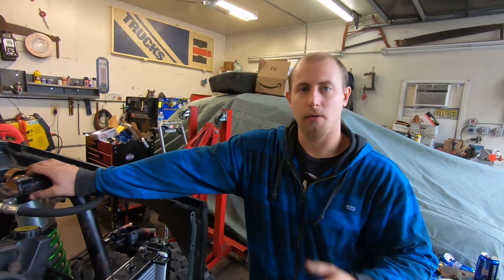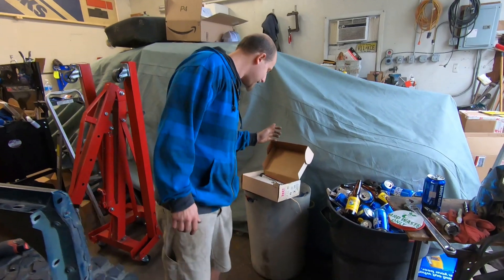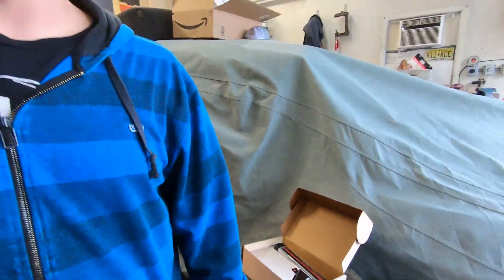We're back the next day with fresh heads, and it really helped. I talked to Anthony, the guy that sold us the computer — he had it set up and tuned for his Jeep. I assumed we could just plug it up and get it started, but obviously that's not the case. First, he had his Jeep set up with a GM 36-tooth trigger wheel on the front of the harmonic balancer, and we don't have that — we have the stock one. I had to change that setting. I also learned we have to set up base timing every time. Our old-school timing light doesn't seem to work, though we confirmed we're getting spark from a plug laid against the block, so we need to go to the auto parts store for a new timing light.